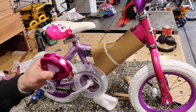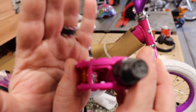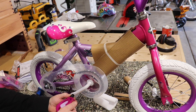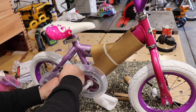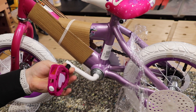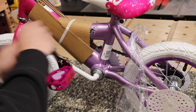The next thing to install are the pedals. These are little heart pedals for the Princess bike. Now these are proprietary — they do have their own sides. If you look at the end, this one here is for the right, and this one is marked L for the left. So this is the right-hand side of the bike — you want to thread those into place. Now these go righty-tighty, lefty-loosey on the right-hand side. Tighten with our adjustable wrench. Now this is the left-hand side — it is not righty-tighty, lefty-loosey. It is lefty-tighty, righty-loosey. You've got to remember that — this one threads the opposite way, and that's why the pedals are proprietary per side. Once you get it in there, go ahead and tighten it up with the adjustable wrench.